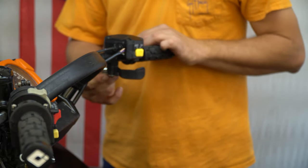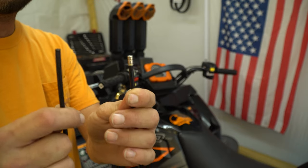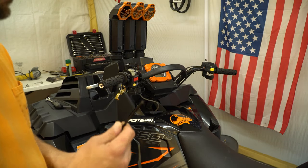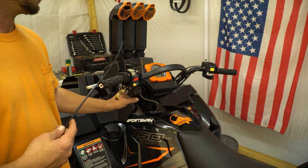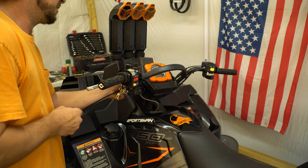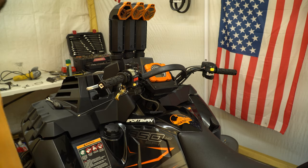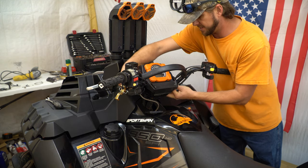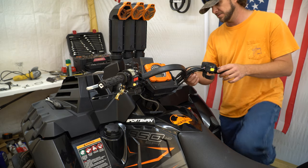Be careful you don't break your lever. Now we're going to take our cable and unroll it. You will notice that there's only one end that's silver — that is the end that is going to go towards the new throttle. We're going to take this end and weave it through. I'm going to go underneath — it says you can go under the padding, so we're going to consider that this gauge pod is the padding because of its location. We're going to push it right through here and get it through to the other side, then figure out where we want it to come out. I want it to go under my throttle cable because I don't want anything on my original throttle cable to hinder its movement.